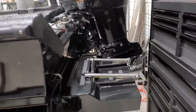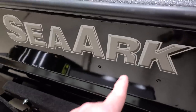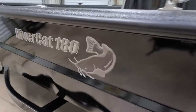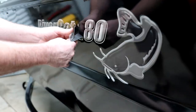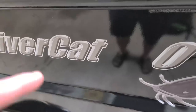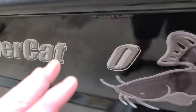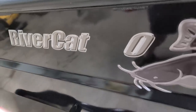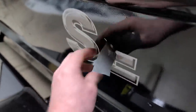I pulled my boat into a different bay where I usually work and it's almost hitting my toolbox. I've got stickers on this boat already. I'm not sure if I'm going to take this one off, but this one right here would definitely have to come off, so I'm going to start peeling it off. I got the one and the eight off, but this stuff doesn't peel too easy. I'm going to get my heat gun and heat it up a little bit — you don't want to overheat it and mess your paint job up, just get it softer so it'll peel off.